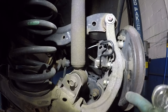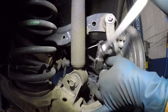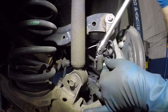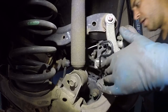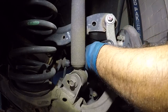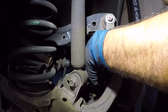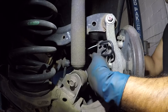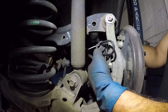A lot of people tighten these to the best of their ability but I do torque my stuff. I need all the clearance and space to do that off-camera. To tighten these, make sure you tighten them evenly — don't fully tighten one while the others are still loose, because that forces one side of the spindle into the housing unevenly. Snug them all in equally, then tighten and torque them. I'd suggest torquing — if you need torque specs, just send me a message.